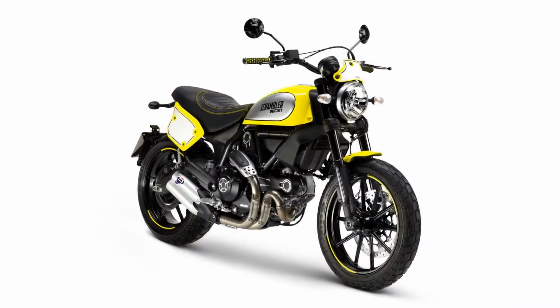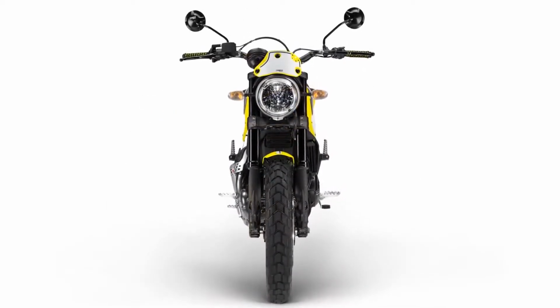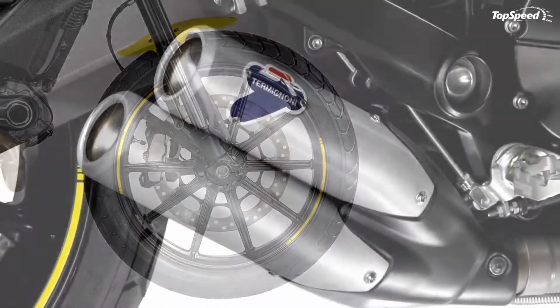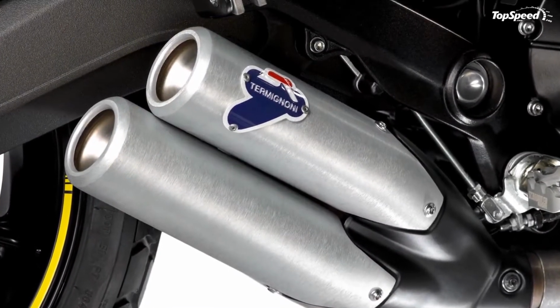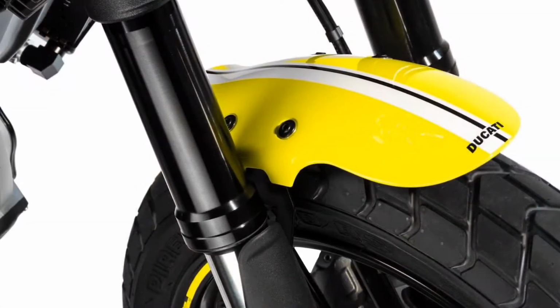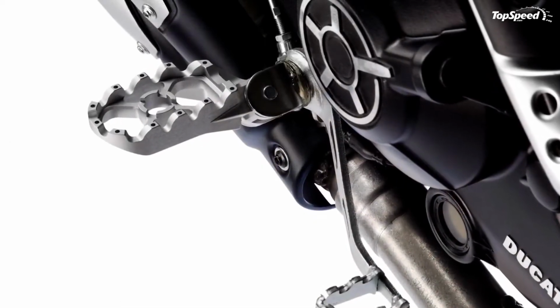A 6-speed tranny handles the ratios, while a slipper clutch couples engine to tranny with an easy pull at the lever and a bit of back torque mitigation to prevent loss of traction. This is a good thing considering the abrupt nature of the throttle, and should help to lessen the risk, if not the annoyance, associated with sudden variations in engine RPM on the downshifts.